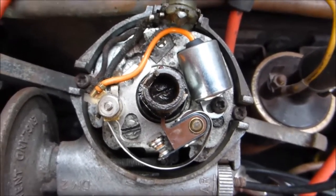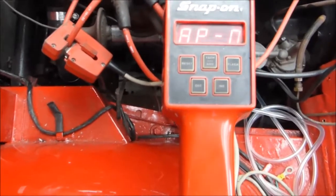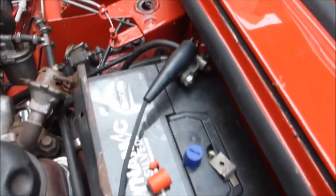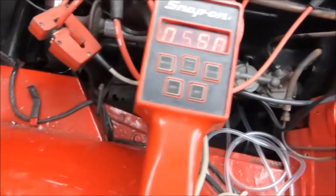In this case, they're brand new. Now, this is the first stage of setting up the timing mark. Down there you'll see I've put some white paint on the timing mark at the top, and there's also a dot slightly back — the timing mark for top dead centre. The engine is static at the moment. This is a Triumph, so it's positive earth on this old Triumph. All ready to go now.